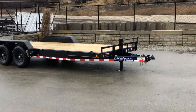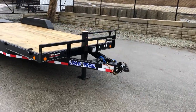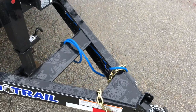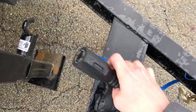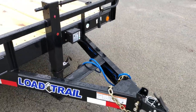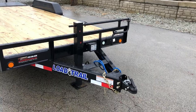Pretty much everything you see here would be standard equipment on the trailer with one exception — this cold weather wire harness, which is the blue harness there, would be an extra. Standard would be a traditional black 7 pin whip. It is a 7 pin plug as you would find on most any truck nowadays. Simply plug that in and it'll activate your electric brakes on the trailer.